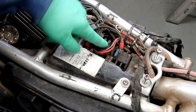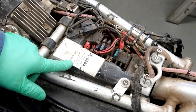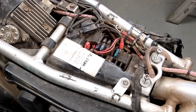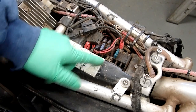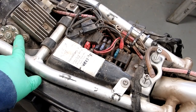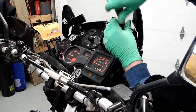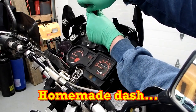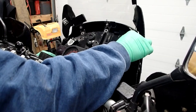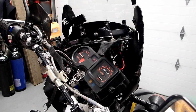There's how I have the electrical — I've got a distribution box set up under here. Everything's coming off. I've got the vest, I've got the two plugs on the front and the heated grips, and I've still got room for two more. I haven't had any issues with it there. I just put dielectric grease on everything — it collects the dirt but keeps it from corroding. And that's the ground block right there. I've got a bunch of ground wires attached to one screw on there.